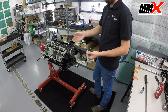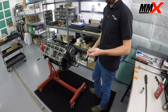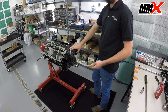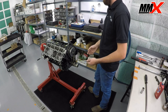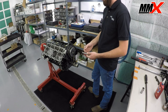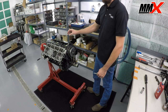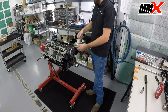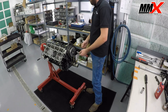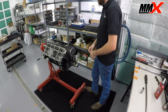We do offer these on the website and they are an option with your camshaft — at the very minimum you can still get them through your dealer. Just make sure you replace this bolt, because it's associated with a lot of failures and there's been a lot of misinformation out there about pins breaking off. The other thing that typically happens too: not only will somebody put the old bolt back in, they won't clean the oil off it, and all that oil has nowhere to go — it can't come back out past the bolt thread. It winds up as a little pocket of oil in the very bottom of the cam bolt hole, which will hydraulic in there. It'll torque down and feel fine, but the oil in the bolt hole means it will not clamp the phaser to the cam properly, and then it'll break the pin off and destroy the rest of the engine.